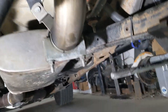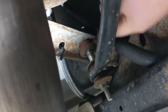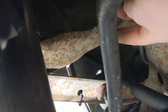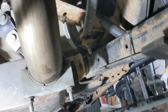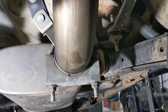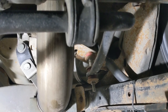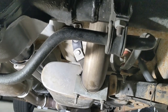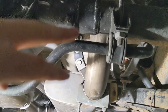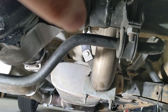This bar mounts right here on this chassis brace that goes from the torque box — basically just the upper control arm mount crossmember — to the actual frame rail. The CPP bar is pretty nice and it's actually made in the U.S. I'm changing this over. This one is one inch; the CPP bar on the table is an inch and a quarter. The inch and a quarter one is hollow, this one's solid, so they should weigh about the same. That one should be about twice as stiff, roughly, depending on how you math it.